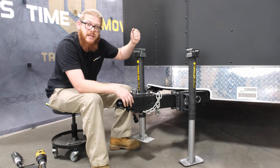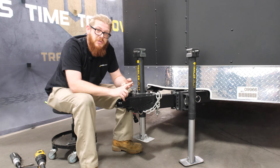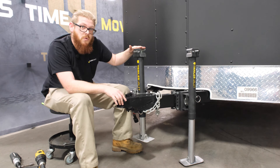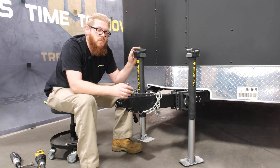That's our new JX series. Now that your jack is installed, to get the best lifespan out of your jacks I always recommend two things: greasing your jack and making sure it's clean after each use. Each jack has a grease reservoir on the back — use a grease gun to inject grease into it. If you use your trailer frequently, grease it at least once every two months. If not, every three to four months is fine.